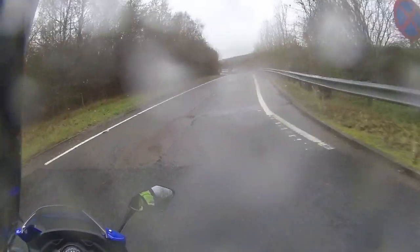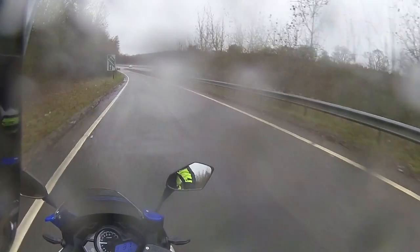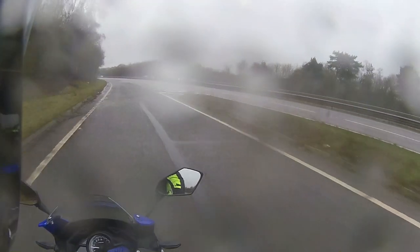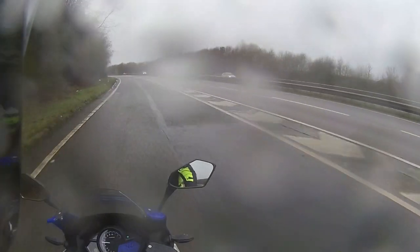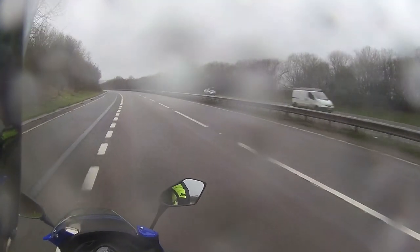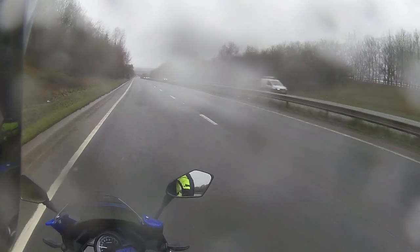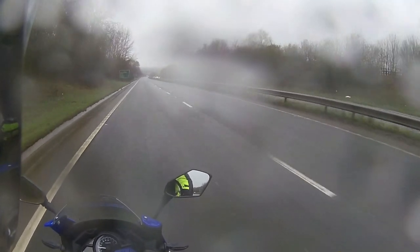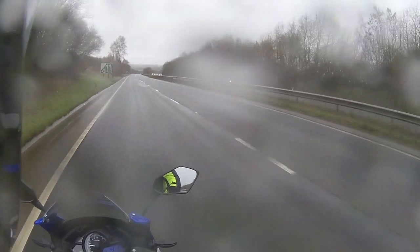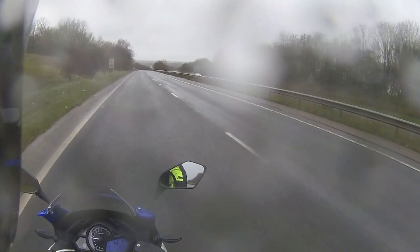I have said over and over again — the tyres on these LX-Rs and most of the LexMotos, even some of the good-name bikes, are using nylon tyres. I never have a problem with the nylon tyres. Obviously on a wet day today she's sitting planted, not a problem at all, but you're going to take your time a little bit more than on a dry day. Even in wet weather these tyres are adequate for what they do. The only time you're going to lose it is if the tyres are cold, there's fuel or muck on the roads, or it's really, really wet — and you are going to lose adhesion on any bike, even from 125s right up to the thousands.